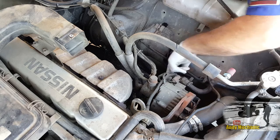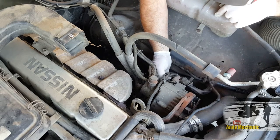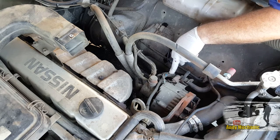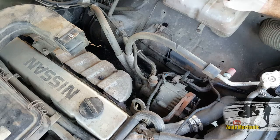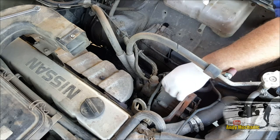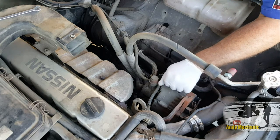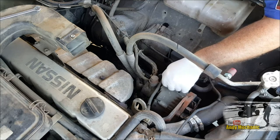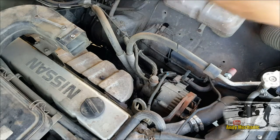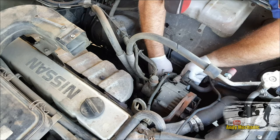So we've got the negative on the battery disconnected just for safety, because we've got a live down here. We're just going to take off the earth first, which is that little 8mm bolt just there. Obviously there are many different types of alternators out there, but disconnecting and swapping them out — the biggest issue is access as opposed to what to disconnect and reconnect. They're not hard, though sometimes you've got to take a load of stuff off to get to them. Fortunately on this one it's relatively easy. Now, the B plus post is spinning on the alternator — the 10mm nut, the M6 nut, is quite badly rusted and it's just turning.